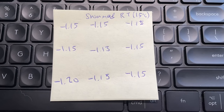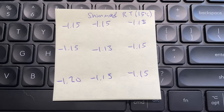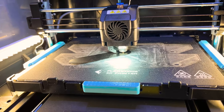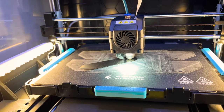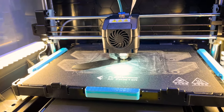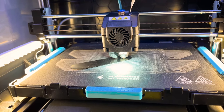After adding shims, the only thing I needed to do was add one more shim to the front left corner to make it even with the rest. I won't bore you with the whole calibration process — I'll come back after doing increments at 30, 40, 50, 60, 70, and 80 degrees on my bed, and we'll see what kind of bed leveling we get.